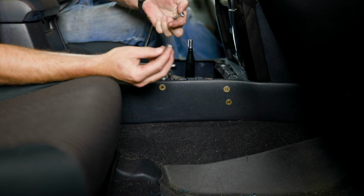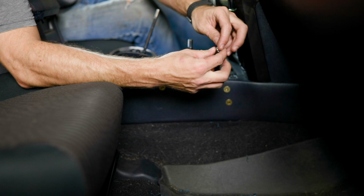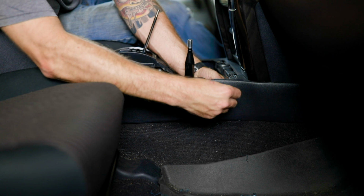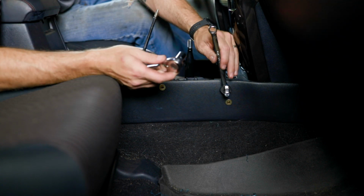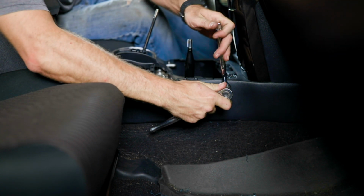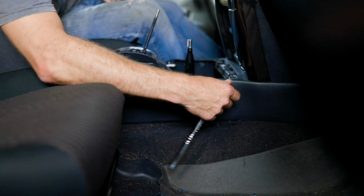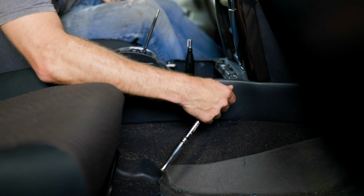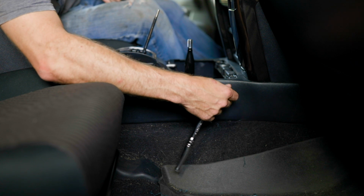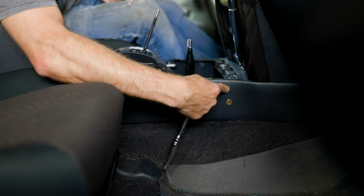After you put them in, you're going to notice in your hardware kit, you get this long nut and this bolt right here. Push those through, thread it into the insert. With a 1/2 inch wrench and a 7/16 socket, I'm now going to use this to crush my threaded insert into place. What I'm doing is I'm tightening it down until it feels snug, and then I'm pulling out. If you tighten them down too far, you can pull the threaded insert through the plastic and mess up your console here. So be cautious not to over tighten these things.